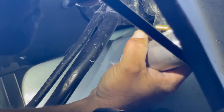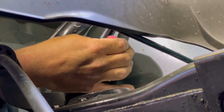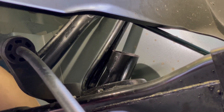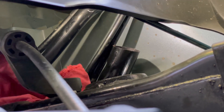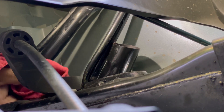We need to clean all this up and get the metal shavings out. I'm going to run a rag through this piece and push all the metal to the other side a couple of times. I'll put the rag through from the other side and push it with a screwdriver. See all that metal coming out? That's why we disconnected the tube. I'll do that four or five times until no more metal is coming out. I may spray it down with WD-40 to help the wet rag grab better.